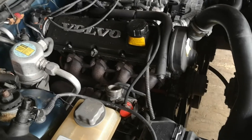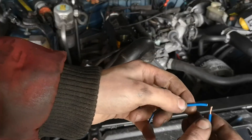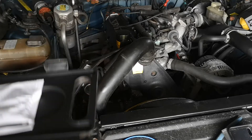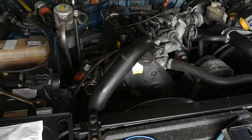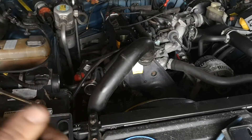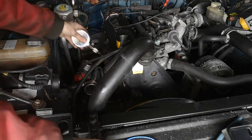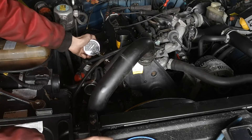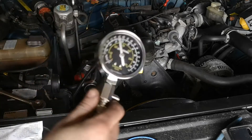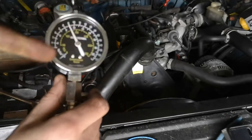Since I'm alone I'm going to build a lone wolf 9000 and then I'll be back. Here we go — a dangerous version of the lone wolf 9000. If you know who calls it that, you're a great person. This is the absolute cheapest compression tester Biltema could get me. Cylinder one has about 9 bars of compression — remember that, that's a pretty good value.